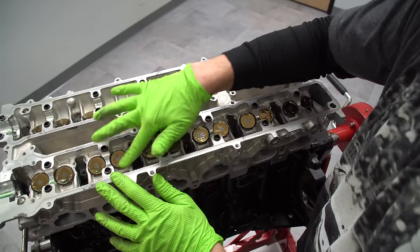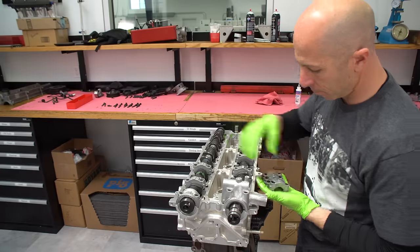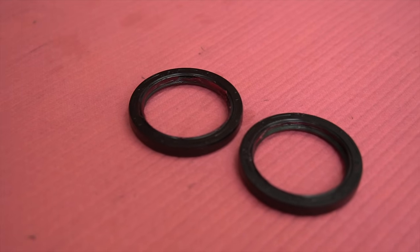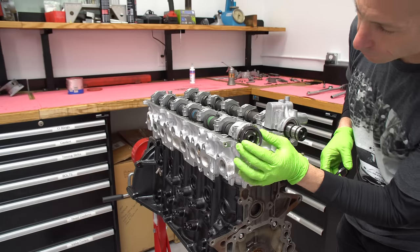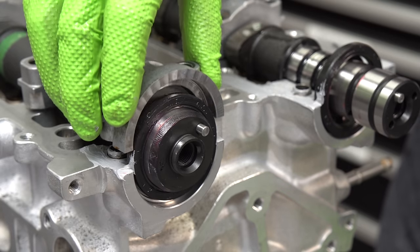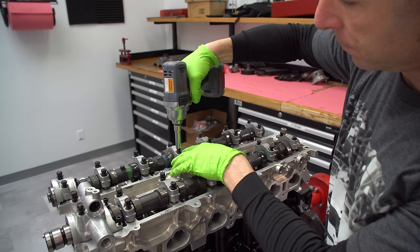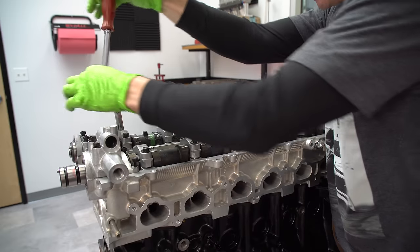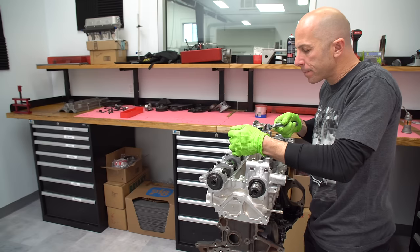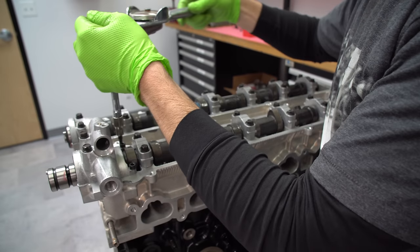These are BC 264-degree cams — it's a relatively mild cam, and for this drift car this is probably the best one for it. A little pro tip: if you grease the inside of your cam seals, front and rear main seals, they tend to seal up and last a little bit longer in my experience. I'll put all the cam caps on and install the cam seals — there's a little bit of silicone that goes under that cam cap. You have to be super careful when you install the cam caps: if you don't have the cams in the right orientation and you start tightening the cam caps in the wrong order, you can actually break a cam. So follow the instructions on the order to put the cam caps in, then torque all of the cam caps.